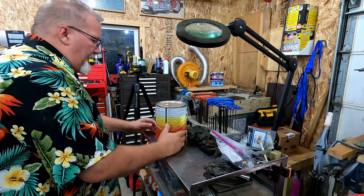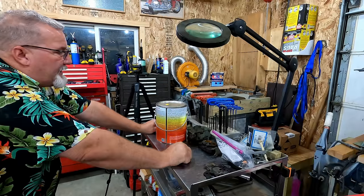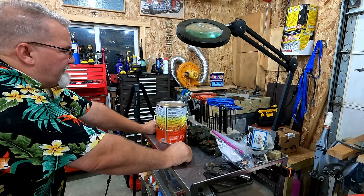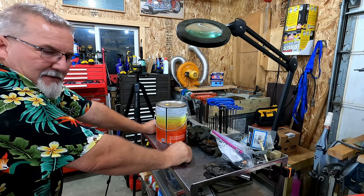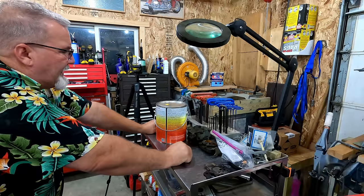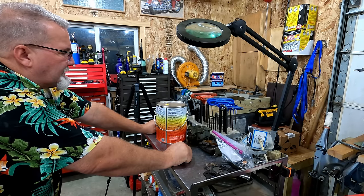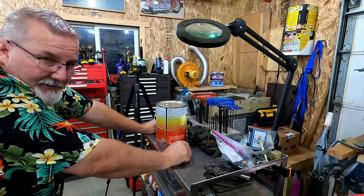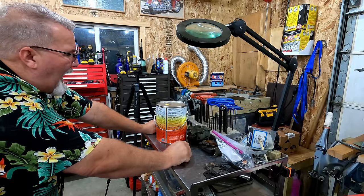Well, I was gonna let this soak overnight, but from what I can see, it just says Berryman Chem Dip Carburetor Parts Cleaner is a highly effective carburetor parts and throttle body cleaner that removes gum, varnish, fuel residue, and other deposits from carburetor parts and throttle bodies in 15 to 30 minutes without heat, aeration, or agitation, safe for use with most plastic and metal carburetor parts and throttle bodies, including steel, aluminum, and their alloys. Limit soak times of coated and sensitive aluminum finishes. In 1973, there wasn't anything known as a sensitive aluminum finish, so I think we'll be okay. For a maximum of 4 hours.